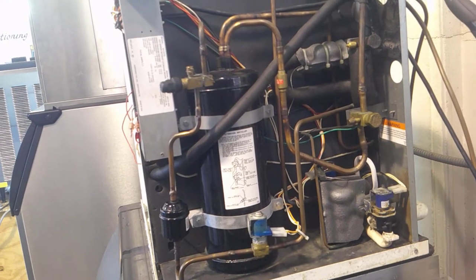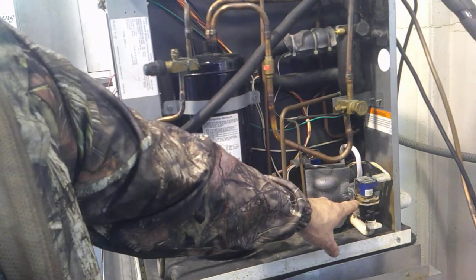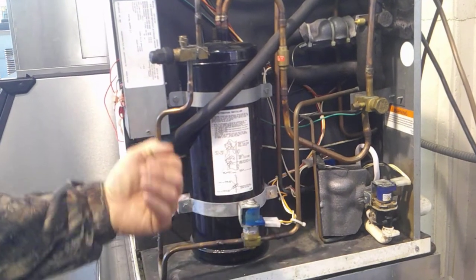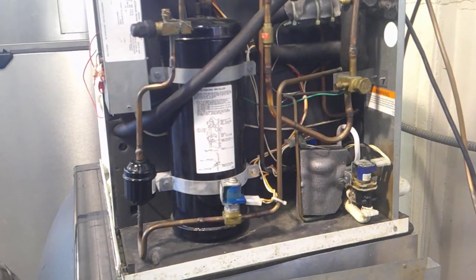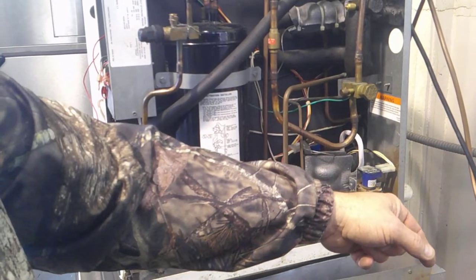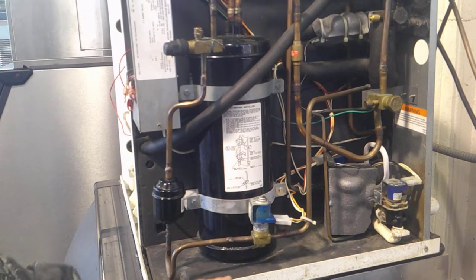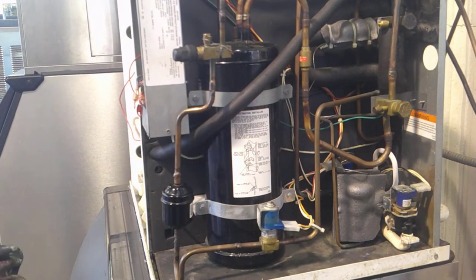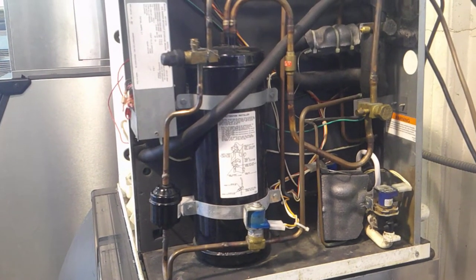In the beginning, the machine energizes the dump valve solenoid and empties the water reservoir to flush out contaminants. This dump valve solenoid is tied in with the water pump — the water pump pumps water up to the solenoid, and if that solenoid is energized, water will leave through it and go down the drain. It does that for about 20 to 30 seconds. Then that solenoid de-energizes and closes, and the water reservoir fills up with water. Once the reservoir fills up, the machine will energize your liquid line solenoid to allow refrigerant to flow through the system, and it will bring the condensing unit on with the low pressure control — whatever the low pressure control cut-in is set at is the pressure at which that system will come on.